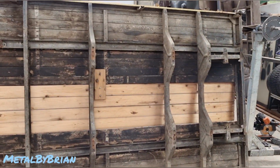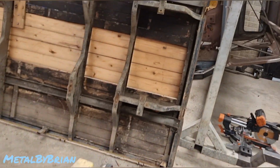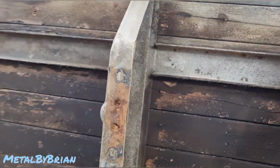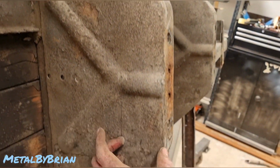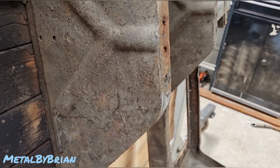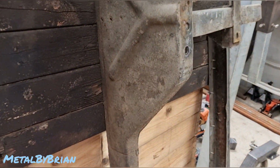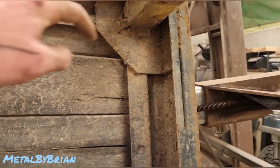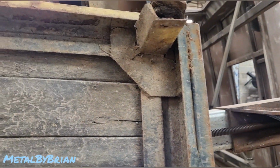I'm just planning on chopping them mounts down. So I've got the materials ready. I've already cut and drilled them. But I'm going to slice along there, 90 millimetres, straight through, and then just weld a new piece in. Things like these, I need to chop that off, really. Maybe replace them for a bit of round tube, because I am going to have a canvas tilt on the back of it.